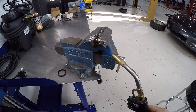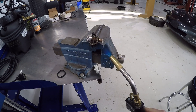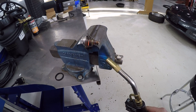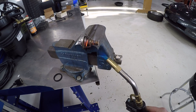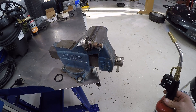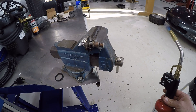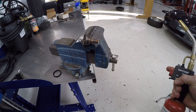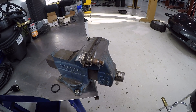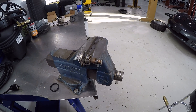We're going to heat this up until we get to 195 degrees, and at that point it'll start to open. You can see it start to open right now. I removed the heat source, and now it's completely open. And that's how it operates.